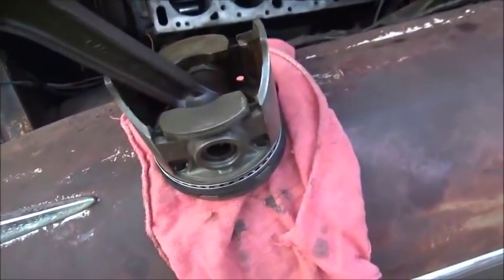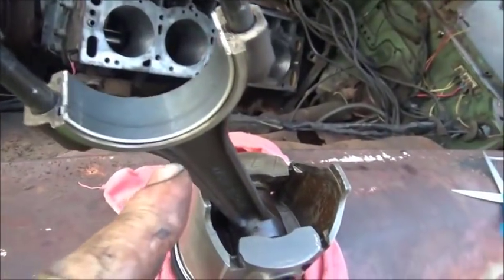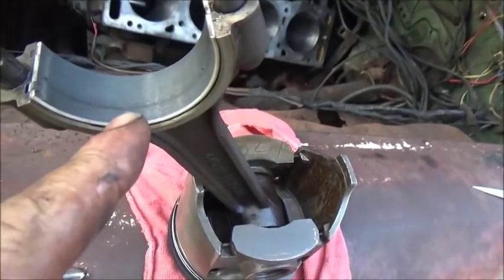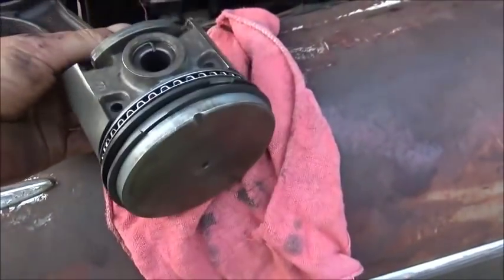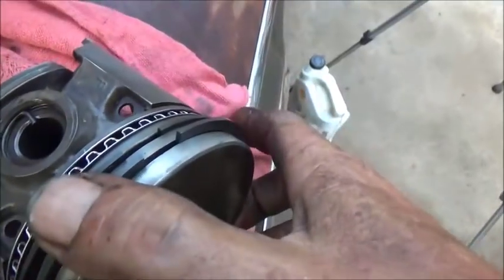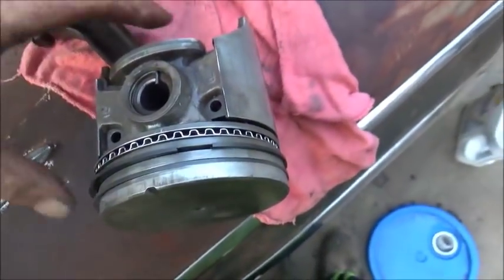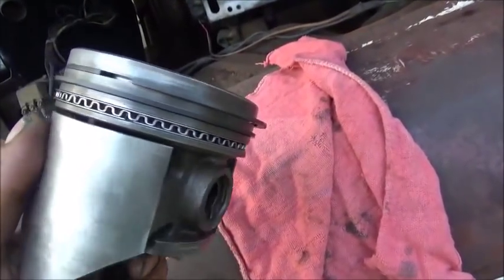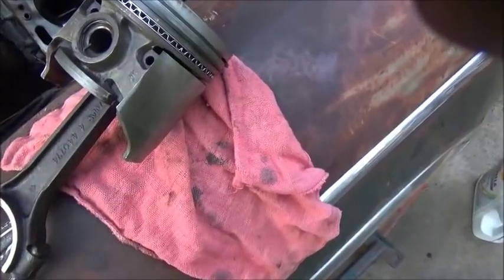Going to show you how I do this by myself. I've got rubber on the ends of the studs, and we've got assembly lube for the bearings. The bearings are used but not in bad shape - if it were discolored in the center where the babbitt surface was coming off, you would know it. Do not line up your rings - I've seen this done before. The compression ring and the second ring cannot be lined up, so you need to clock them.